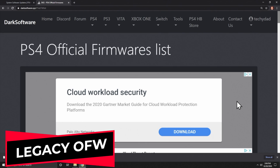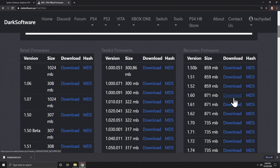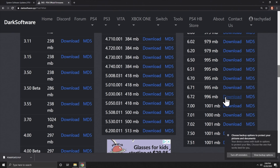For legacy official firmware, darksoftware.xyz is a fantastic archive and repository for PlayStation content run by PlayStation gamers and modders. If you need to install a version of the official firmware other than the most recent one, this is a great place to go — they have all versions of recovery software available for download. The PS4 I showed at the beginning is on version 6.72, so going higher means you won't be able to jailbreak it anymore. Note that PS4 official firmware is not backwards-downgradable — you can only go with the version currently on the console or higher.